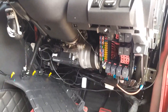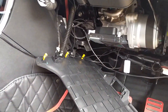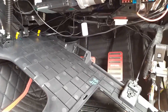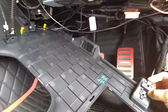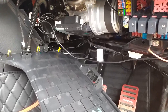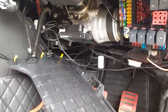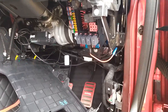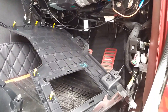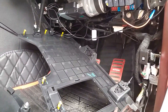That's pretty much how to access your under-dash trim. You can take this off as well — it's just a sensor, I'm assuming an air sensor. You can also take off the boot release and bonnet release — it just slides out, and then the whole trim comes away for you to work on. It really isn't that hard, just please be careful with your clips. You may potentially break some, but you can pick them up off eBay, Amazon, or AliExpress.